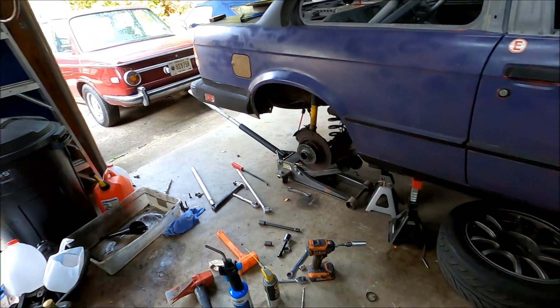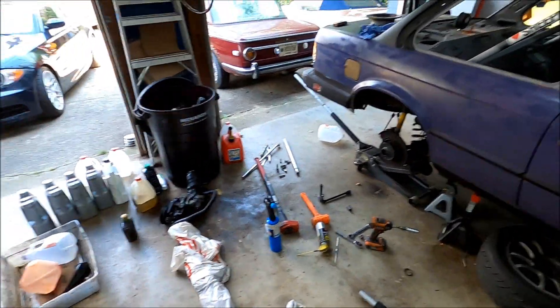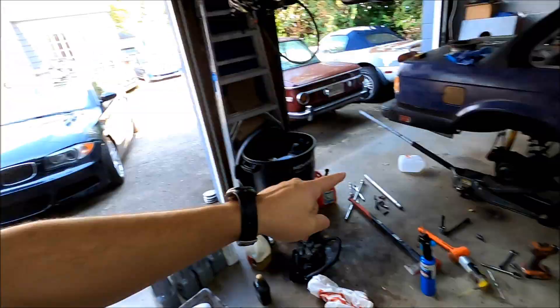Well, here we are. I've tried lots of things. The axle is all loose except inside the hub. You can see the methods of attempted removal and it's not working. I've got it soaking with penetrant oil. Tried hammering it out — broke a three-jaw puller. So maybe this axle will come out, maybe it won't, might just go back together the way it is. Last update on the E30 axles: we've tried everything — big hammer, big heat, lots of PB Blaster over a week's time and it's not coming out. The next step would be to beat harder until you deform the axle, or pull the whole rear trailing arm out and put it in a press. We don't have time for that — race is in four or five days. So it's going back together with a new nut and lock washer. Ship it. Hopefully the axles stay together for one more weekend, and then we can pull it all back apart, pull the rear trailing arm off, and take it to a shop that has a big press.